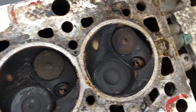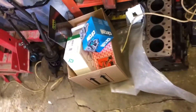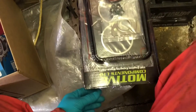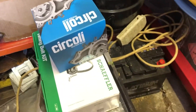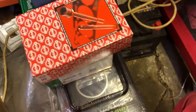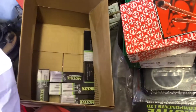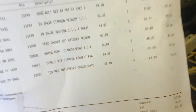Welcome back to the garage - it's after lunch and I've got car parts. There's the head on the bench, a head gasket set, cam belt kit, hopefully the right one, a water pump, a set of bolts, some new coolant, and a whole set of valves. I got a whole set because I don't know how many are damaged, and it's way easier to get them when they're on the shelf than to go back when they shut at four o'clock.